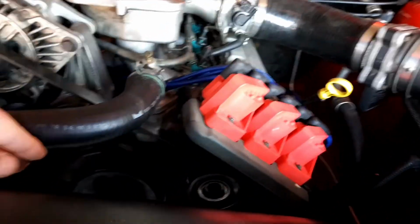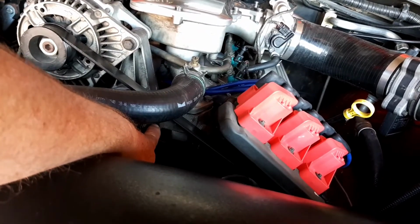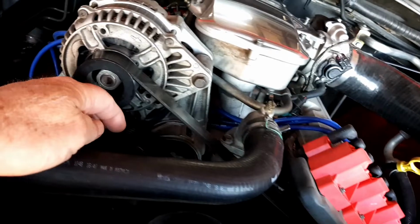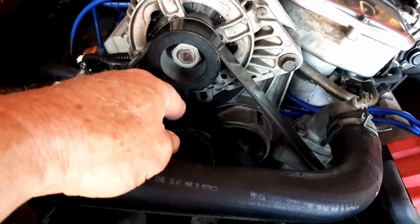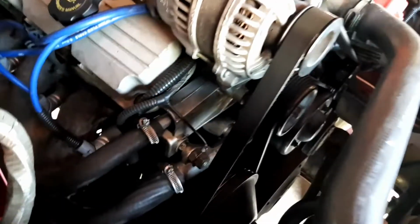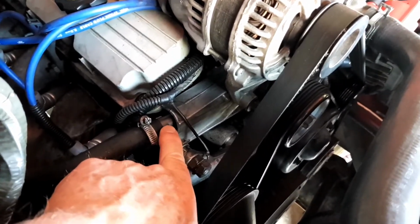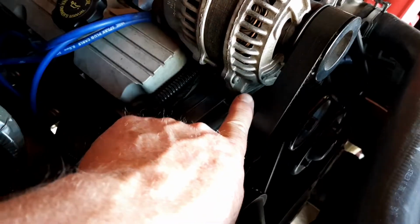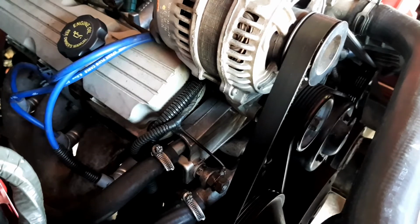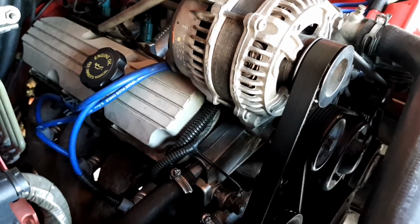Now, I don't know how well I can film this, but the pipe in here that goes through the belt tensioner bracket, which is here, I'll just try and get a better shot. So there's the end, there's the other end of it. So that pipe going through, I put a bit of rubber grease on the O-seals because I didn't want to bind them up, put them in. That was a good idea because the O-ring slipped off.